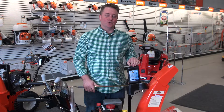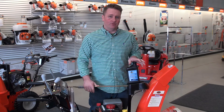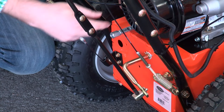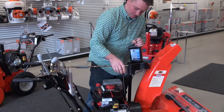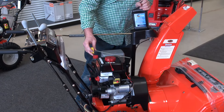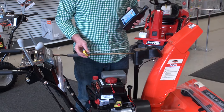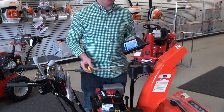When it comes time to replacing the oil in your snowblower, first you want to make sure you've reinstalled the oil drain cap. Next, you want to take your oil cap off. You can take your oil and pour usually about three quarters of this quart directly into the snowblower.